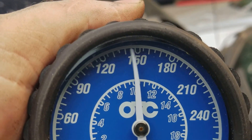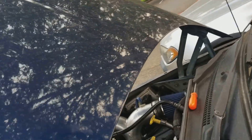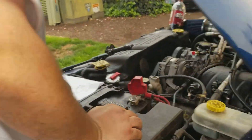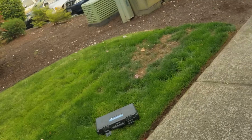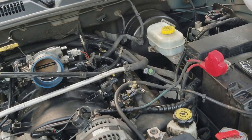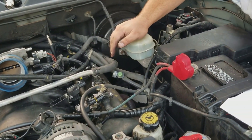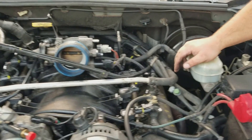There you go — for the video. It's 150. More than 120, I'm happy. Some cylinders crank longer. Yeah, it's got 180,000 miles. If it even gets up to 150 at this point, you're doing good.